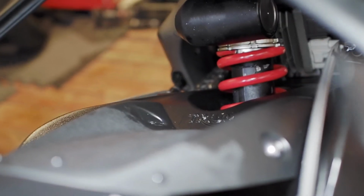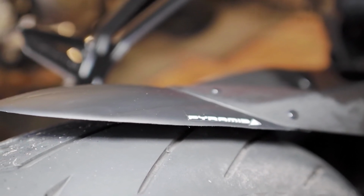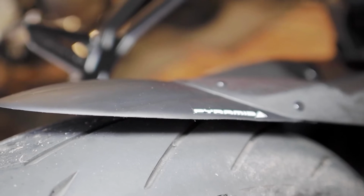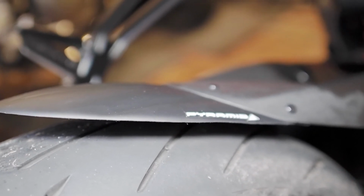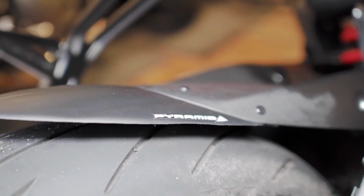Now some people suggested using a rear shock sock. Now that does give very good protection against muck, stones and anything hitting the shock, but if it isn't taken off and cleaned after every ride you'll end up rubbing the muck and stones that collect into the shock into the rear shock. So unless you take it off and clean it after every ride you won't be any better off. So I decided to go with a hugger extender.